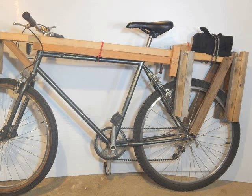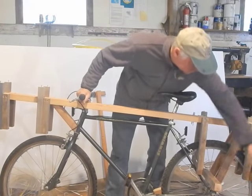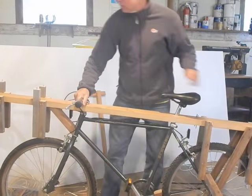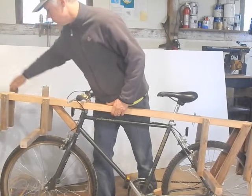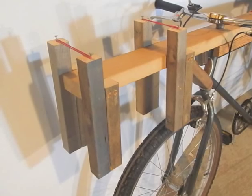This is how it looks all put together. Sixteen-penny galvanized nails were used to attach the 2x2s to the 2x4s. I pre-drilled some holes and put the sixteen-penny nails in for a little hinge point too. I use little rubber bands to keep them up when I'm traveling.